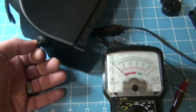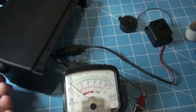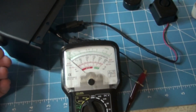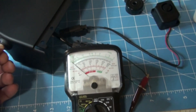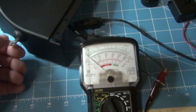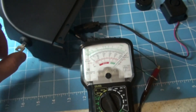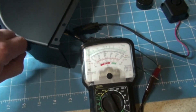For the first test, I'm going to turn the race fuel key — we've got a multimeter attached and we just want to test continuity. When I turn the key, this needle should swing from the far left to the far right. And there we go — we turn the key, and then turning the key back off, we want to see it go back down.